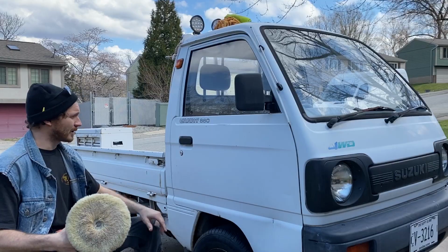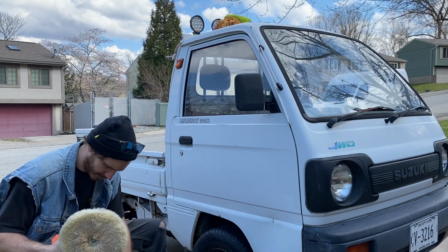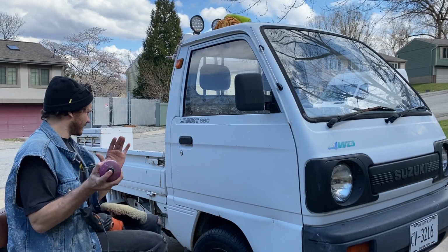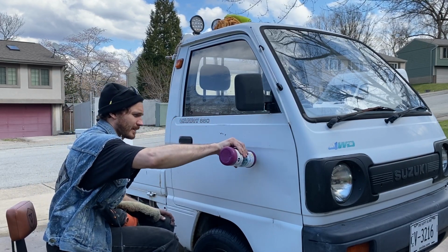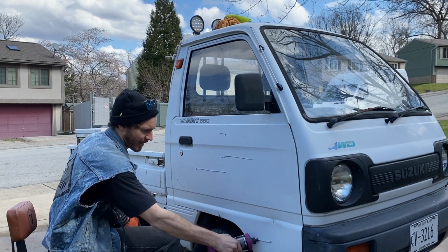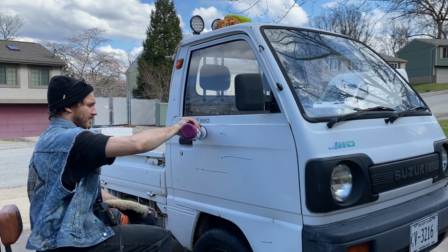I'd love to hear. Hey, we're going to start the buffing process now. You got your wool pad. We got this, and we got a 3M number 2. Give it a little shake. And then we're just going to kind of put some on there. It's okay if we go a little bit heavy at first. We need to get our buffing pad saturated, but nothing crazy.